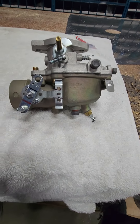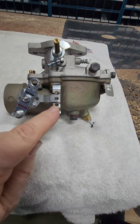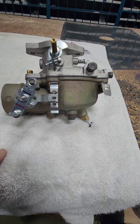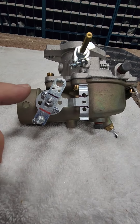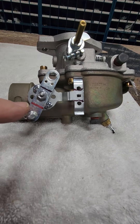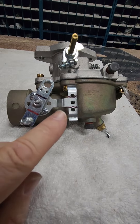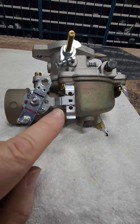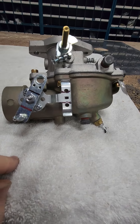I've marked this out a couple of places. Here you can see we're going to cut this bracket off here and up here, so all I've got is the one hole in the middle. Then this bracket is going to get cut at the black line up here and then bent 90 degrees. This bracket about right in here is also going to get bent up towards this 90 degrees — that'll all make sense in a minute.